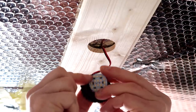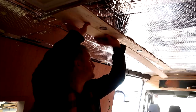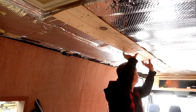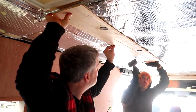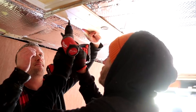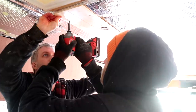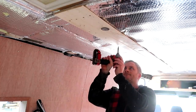The lights have these rubber things around them to give a nice friction fit. We can then add the next board and a rubber mallet helps to get the tongue and grooves together. We're securing everything by drilling some countersunk holes and adding screws into some plywood battens which are underneath the insulation, secured directly to the metal ribs of the van.